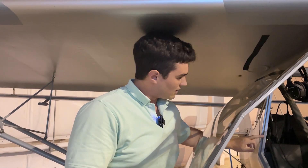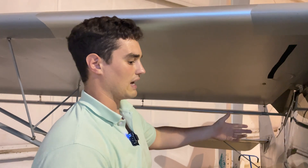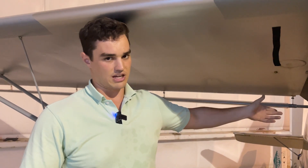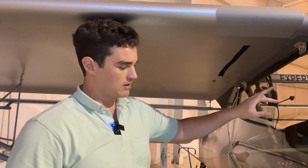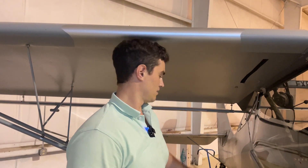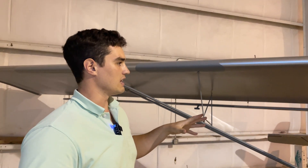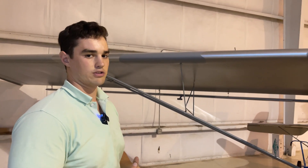I feel like Kit Fox could solve that problem — these doors get pretty rattly in flight. If they put another gas strut on the back side, I know it would add weight and complexity, but that's one of my complaints about the opening doors. Also, if you drain from the wings you're in the same boat — you have to sit there and hold a tank, and it just spills fuel everywhere. Also, I'm pretty sure if you get gas on the polycarbonate it'll crack it — definitely not testing that theory. Anyway, the tanks are drained, gauges are pretty much empty, and we'll move on to the next steps.